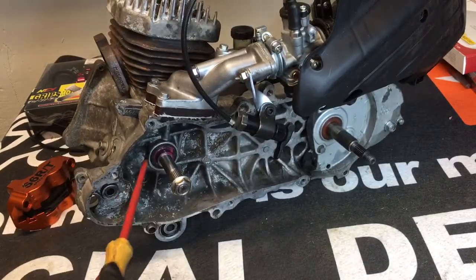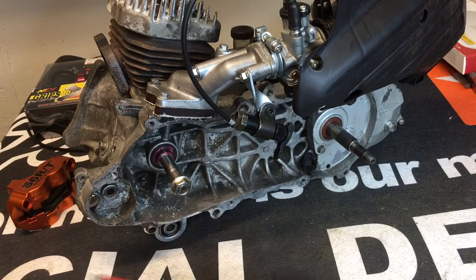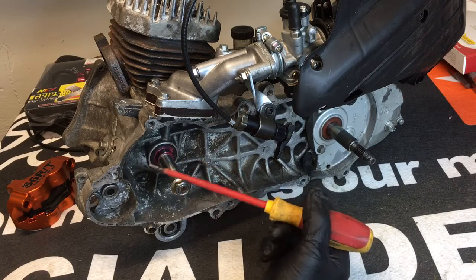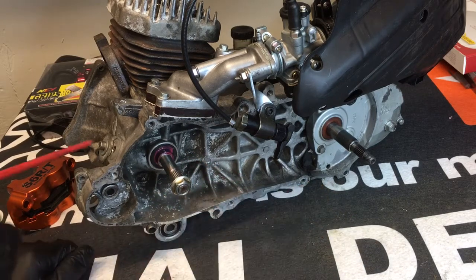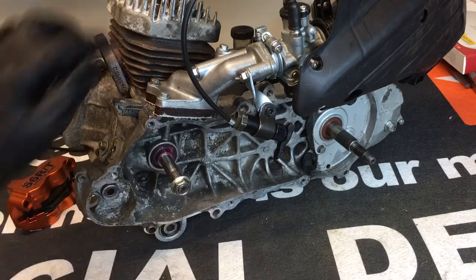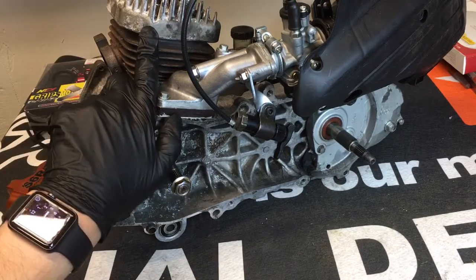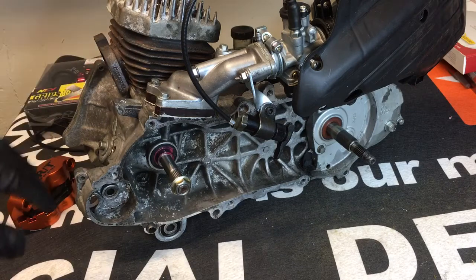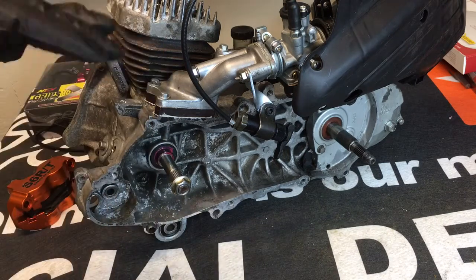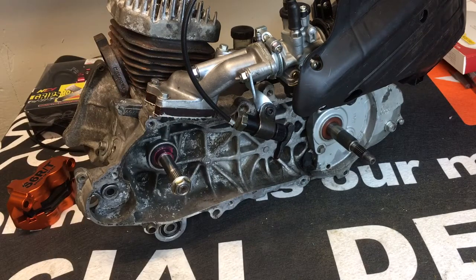Your two seals are a source for air leaks — not common on newer builds, but on older bikes with a lot of miles they dry up and that's pretty common. On both the AF-16 and AF-18, these two seals, the gaskets in between, your base gasket and head gasket — if you're using a Malossi or Polini head gasket that has an O-ring, a lot of times that O-ring will fall out of position, squish, and you get an air leak. I take a little Honda Bond, wipe it on the O-ring, set it in the recess, then slap it on so it stays in place. If you're running a flat Taiwan-style stamped metal head gasket, use some type of sealant. I'd really advise against red RTV — Honda Bond and Permatex are really good for this application.